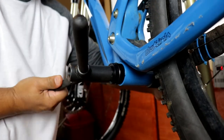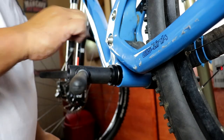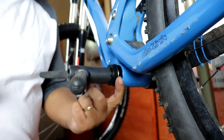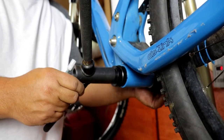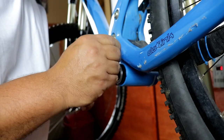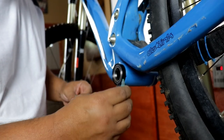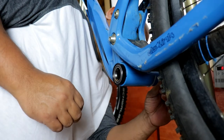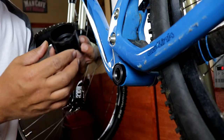Getting close to the end here — about a quarter to three-eighths of an inch from the end. What I want to do is stop, because the next thing is to put Loctite on the inside of the bottom bracket. Take everything off, and we're going to put some of this pretty liberally — enough to fill and get this tight, but it will also prevent water from getting into the frame.